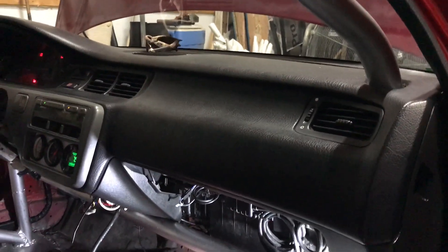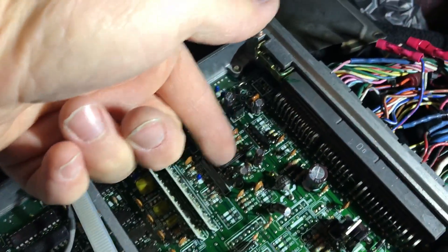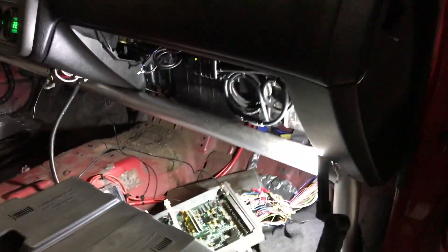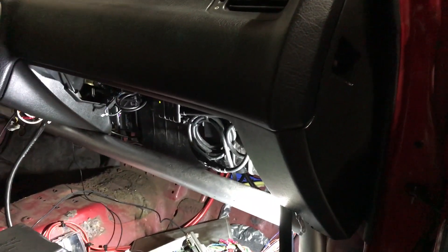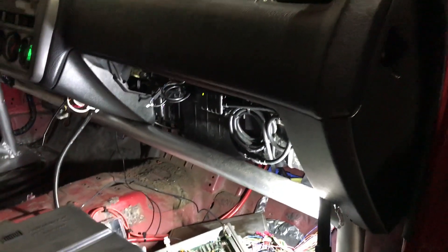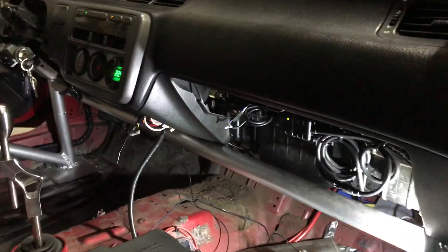That is generally a good way to help diagnose where your problem is. If you've already changed your main relay and this little guy right here — IC17 — seems to start working after it warms up and triggers the fuel pump, hopefully this will help anybody who has gone past the main relay problem and never figured out why the fuel pump won't engage. Hope it helps — everybody have a great day.